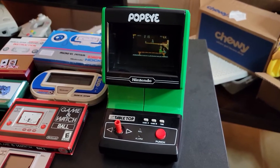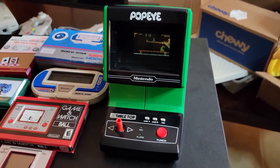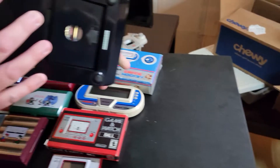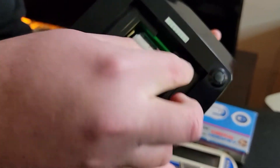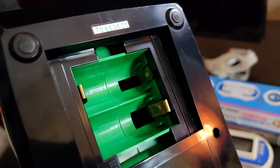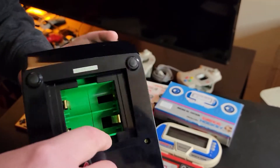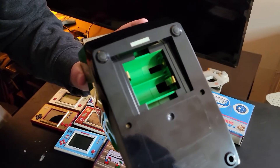I think we'll show you the battery contacts in a minute. That's the biggest thing to look out for when you're looking at something like this. You want to look for simple signs of corrosion. Make sure that there's nothing that leaked in terms of the batteries. This one takes C batteries. The contacts are both bent and you can also see some signs of corrosion on there. The best thing to use to remove corrosion would be something like simple white vinegar — just with a Q-tip, swab it off. The contacts might be bent so your connection from the batteries needs to be good.